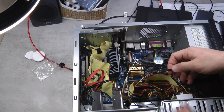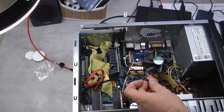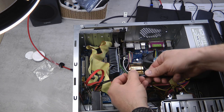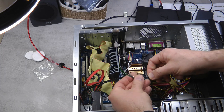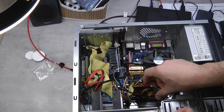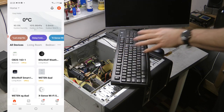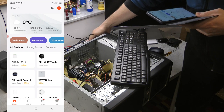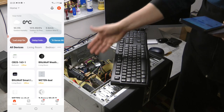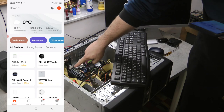The installation is complete. The card is inserted, the two wires from the reset and power switch are connected to the male connectors, and the female connectors are connected to the motherboard where the original wires went. Make sure exposed metal contacts on the other side aren't touching anything — you might want to put some tape on them. I've also hooked up a screen and keyboard to confirm everything works. I've connected power to the desktop and turned on the physical switch on the power supply so the motherboard is in standby mode.